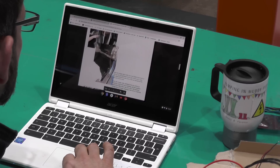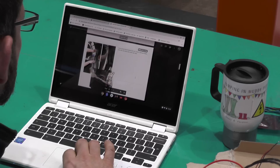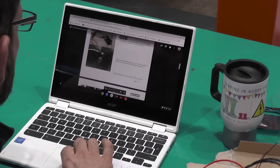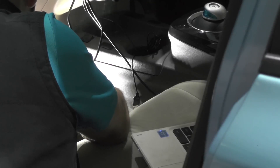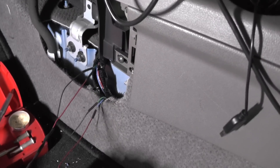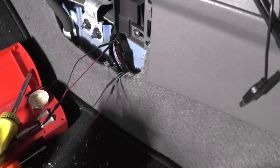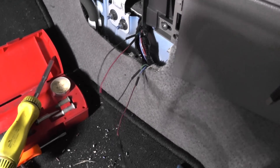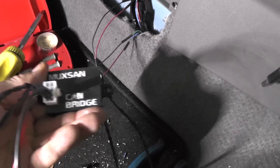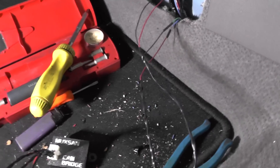Being our first 40 kilowatt hour upgrade, it was important that we familiarised ourselves with the instructions supplied by Muxsan. With that I was straight into the nearside footwell to carry out some splicing and soldering work. This is the wiring that goes into the battery — the CAN wiring — and we're interrupting that, then coming through this bridge here, which is going to intercept that CAN bus and alter it as needed.